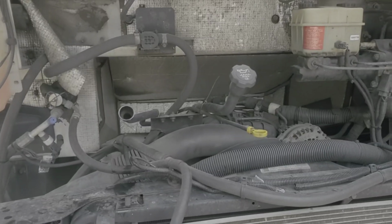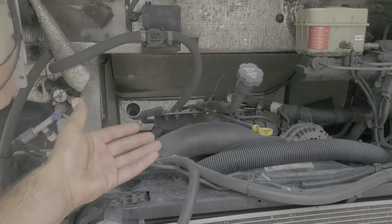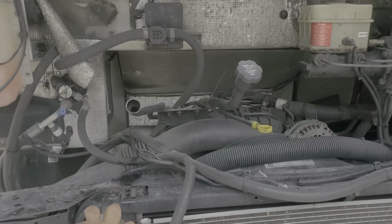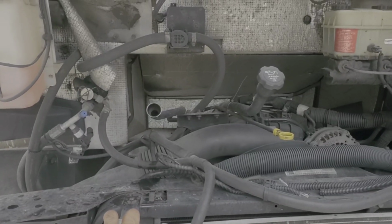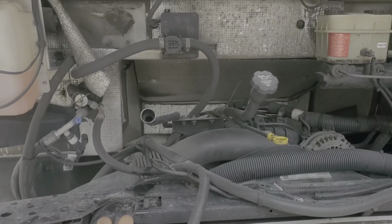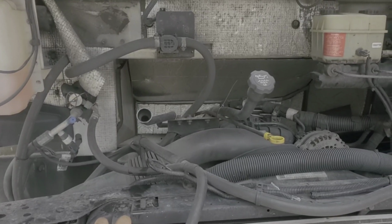It's just the way it is with transmissions, especially because, you know, oil will stay on the dipstick tube on the inside when you're adding oil if you don't have a fancy pump to add it. And you'll just be dragging transmission fluid on the dipstick. But anyway, just finish off getting it up to temperature. Check that level, make sure you're good to go on the hot setting. And that's a wrap. So there you go.